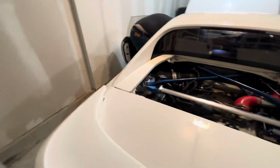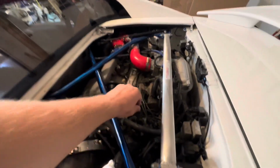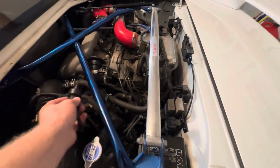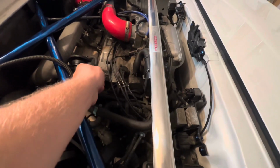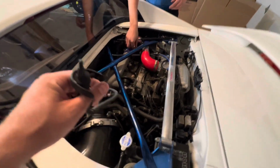It's Derek doing a little background footage for Brendan real quick. One thing I wanted to say is we had this engine temperature sensor. Just going to remove this bracket right here. We're going to run it under the air box and just right over to about here, zip tie it somewhere around here, just so it's kind of functional where it was. I don't think it does all that much, but good to have it because it's factory spec. So I actually think this is a pretty decent little spot. I'm going to cut the zip tie and it should be good to go.